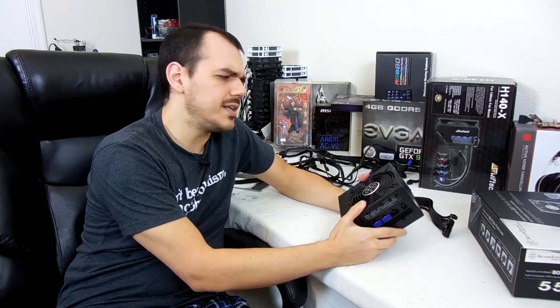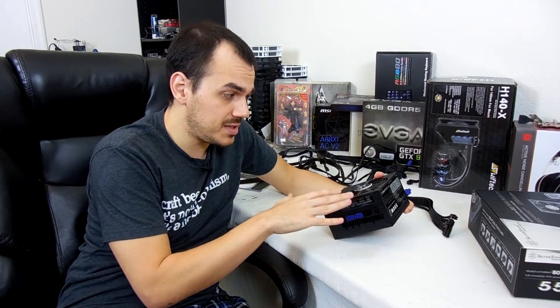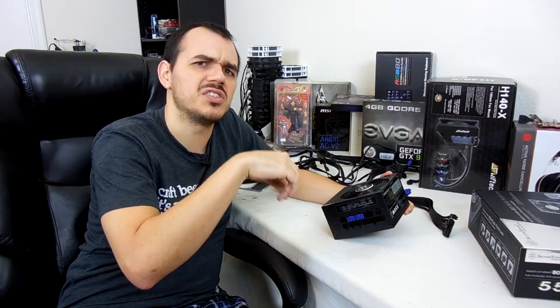What this Sense cable is doing is it's tied into the voltage regulation circuits for this power supply, enabling it to more accurately determine what your 3.3, 5, and 12-volt loads are for your system, so it knows more effectively how to deliver power and where to deliver it. It is not a second 4-pin EPS 12-volt connector. Now, this power supply is also compatible with Silverstone's Shorty cable kit. I like that because this is a very small form factor power supply — it really needed to have short cables in the first place. Their website states it is compatible, and if that changes I'll add an annotation letting you guys know.